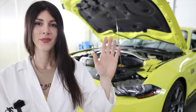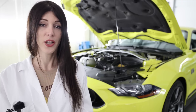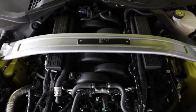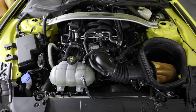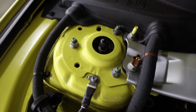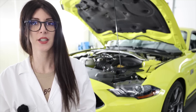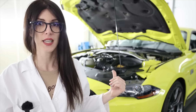Hello and welcome to garage science with Sarah. Under the hood of this 2021 Ford Mustang Mach 1 is a 5-liter naturally aspirated all-aluminum V8 that produces 480 horsepower at 7,000 RPM and 420 pound-feet of torque at 4,600 RPM. I just realized even the Coyote has plastic valve covers. I do like that the strut bar has Mach 1 on it. There's also an optional handling package that gives you adjustable camber plates on top of your front struts for the MagneRide. One could make the argument that the Mach 1 is basically just a re-stickered Bullitt with an available 10-speed auto — and they'd pretty much be right. The only thing that really sets it apart from a GT mechanically is the GT350 intake manifold and some oil coolers, which is what gives it the extra 20 horsepower.